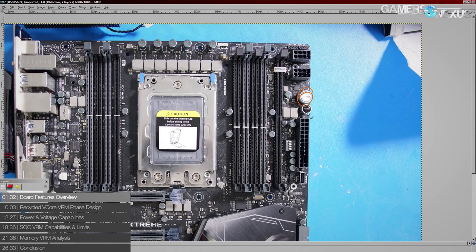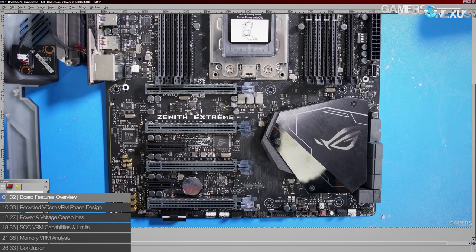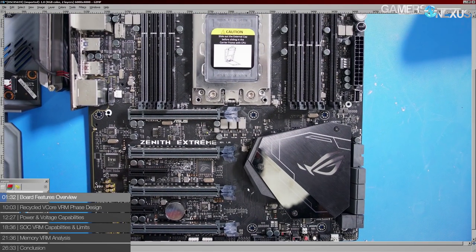Under the eight-pins you find a power button and reset button. Below that there's a 24-pin connector, and next to that you find a four-channel dip switch for enabling and disabling the PCIe slots. This is useful if you have a water-cooled or liquid nitrogen-cooled multi-GPU setup, or if you want to disable one of the cards without physically removing it from the system. You just flick the switch for that PCIe slot and it'll disable that card — a pretty handy feature.